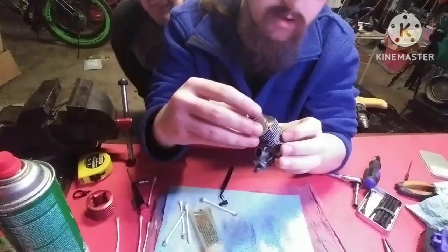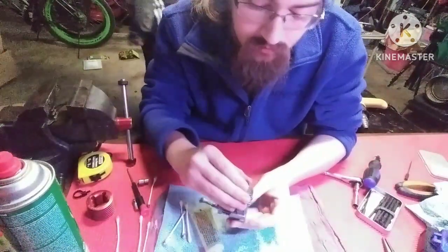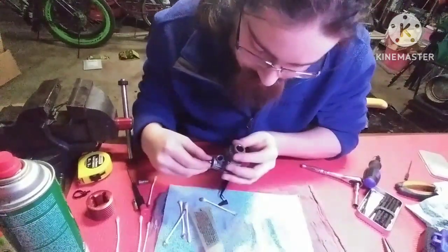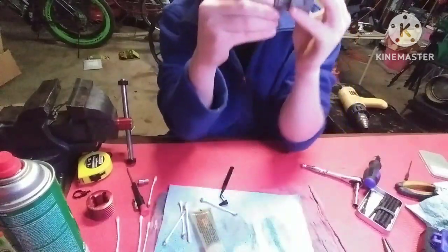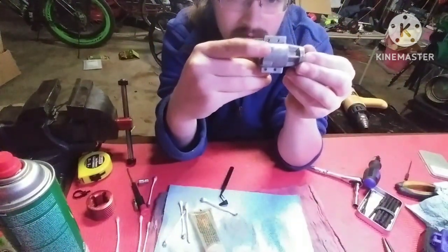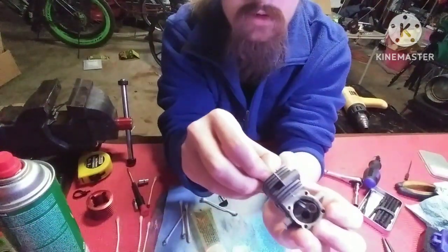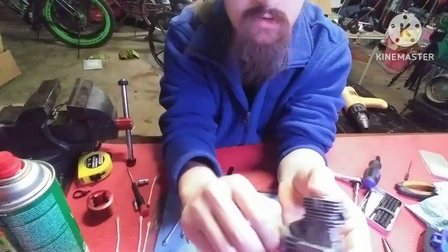Your sleeve back in, you want to bring your piston all the way down to the bottom, and slowly put that down there, and then you can kind of jimmy the crank back and forth until your piston lines up, falls back into place, maybe even flip this upside down. And it'll eventually all fit back together. You want to line up this notch with your sleeve, with the pin on the case, and you push that down, and that's all good. And you got your sleeve back in.